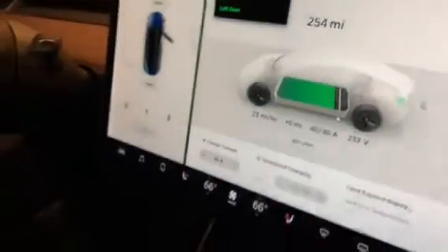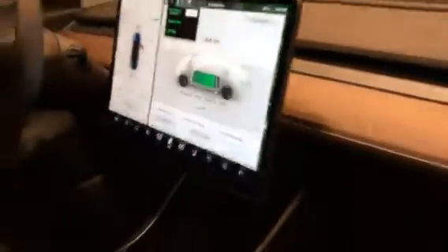We're going to charge this one. We'll take a look here through the window and you can see it's just starting to charge up, and it's set itself at 40 amps. Let's go back and look at the Model S — you can see it's at 40 amps. So now it's doing 40, and so is the Model 3, also now charging at 40 amps. It's basically split the 80 amps — 80% of the 100 amp circuit.